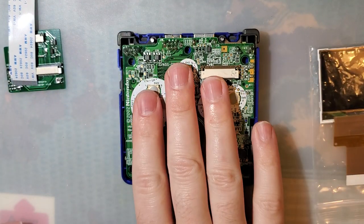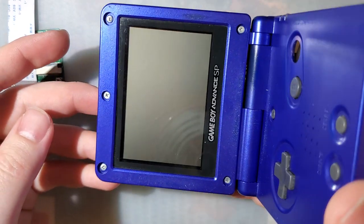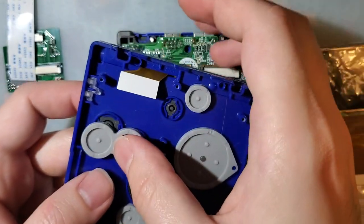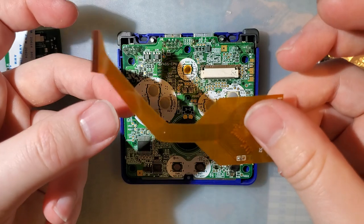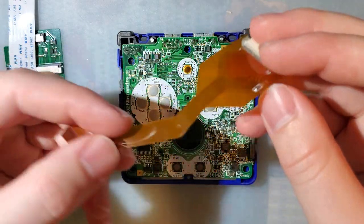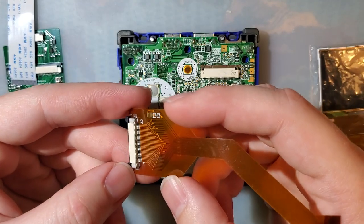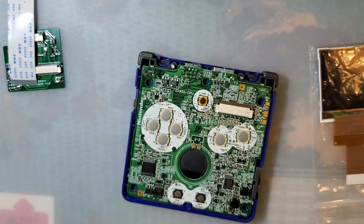But anyway, this is gonna be good. I'm just so excited to do this. I do already have my Game Boy Advance taken apart here. We've got the AGS-001 variant, but this mod is mostly compatible, I guess. It's designed for a Game Boy Advance, not a Game Boy Advance SP, so with the adapter that we're using, this bad boy, we could use an AGS-101 as well as an AGS-001, because this just ignores those last two backlight/frontlight pins anyway. But if you have an AGS-101, I really don't know why you'd be doing this mod. But anyway, let's go ahead and get started.